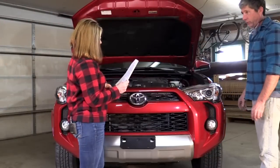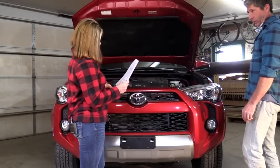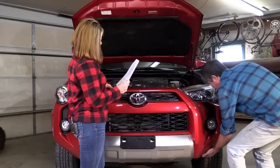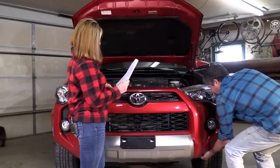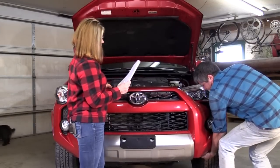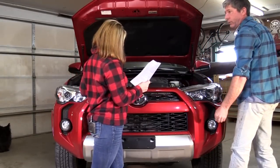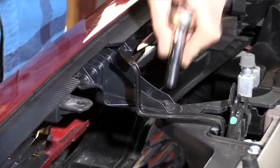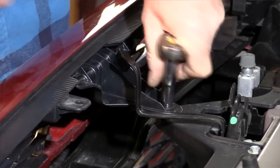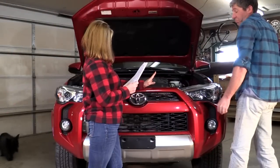Next, stand in front of the vehicle on the same side that you just started removing the bumper cover. By pulling at an upward angle and towards you, disengage the large plastic latches located in the circled area. Warning! If the bumper does not start to easily come off of the truck at this point, stop. Be certain that absolutely no clips or bolts were left impeding removal.